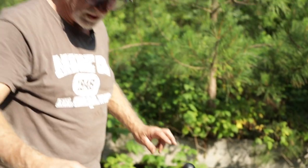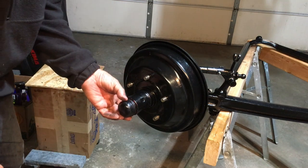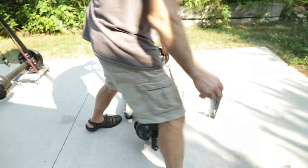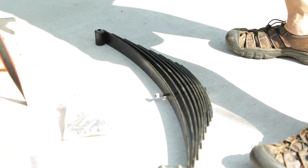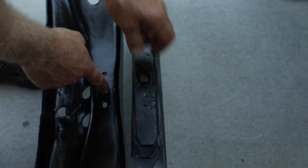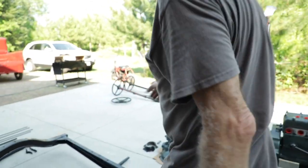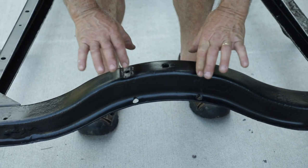I also need to adjust the wheel nuts — you tighten them to the tightest point reasonably and then back off one position to get the cotter pin in the right hole. The front spring assembly mounts right here on the frame with a bolt that ties everything together; it fits right through this head right here. The rear end fits right into this groove, and then the clamps go down through and are held with clamps below.